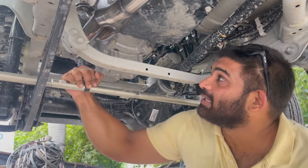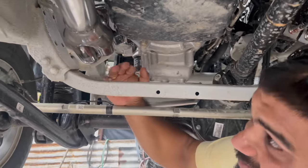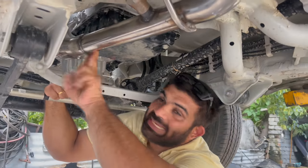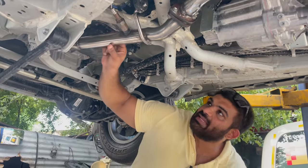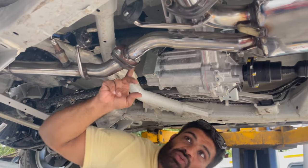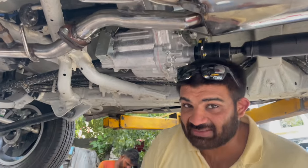So quickly showing you how the exhaust has been mated. This pipe right here — that's four going into two, still into two. So this becomes the long tube — it doesn't merge till here, then it makes a Y and becomes a four-into-two-into-one right here. This is the down tube, this is what you call the Y pipe or collector. If you can see, it forms a Y and then it's a neat 2-inch 51mm pipe that goes here. This is one piece, that was the second piece, this is piece number three, this is piece number four. The exhaust comes in a complete four pieces — very neat plumbing and very good quality.